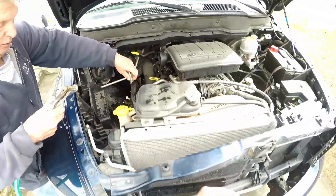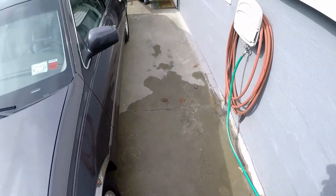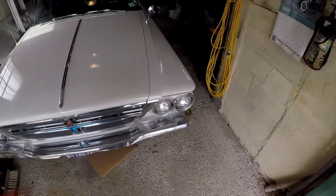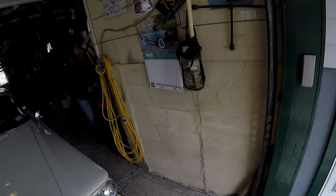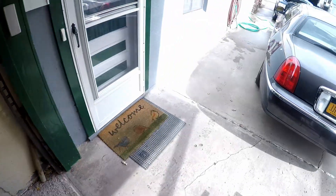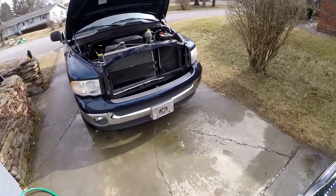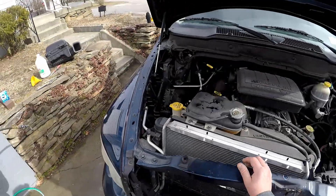It's coming right out and it looks clear. I don't think the problem is your heater core — I think it's a blend door sticking. It's weird that only one side wouldn't get hot. He's had it flushed so many times before. Maybe the flushing is what fixed it each time. Very strange symptom but he says once he flushes it he gets heat, so it must be doing something. Now he'll blow it out with air.